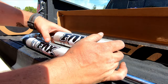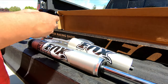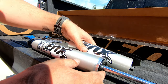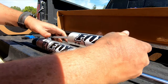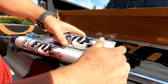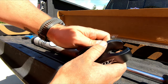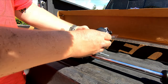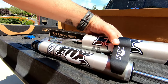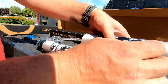Looking at the front shocks, you can see you've got the reservoir here. Looking at what came in the box, it's going to be mounting hardware for this reservoir. Now if I had a lift or anything on this truck this bracket would be a little bit longer. I could move it in different directions — I could possibly twist this one around and mount it toward the front. I've got a big coil spring in the front so I need to mount this behind it, and whichever side it's on will determine a lot about how I mount the reservoir.